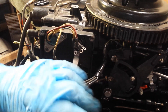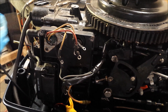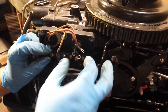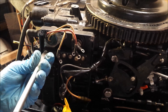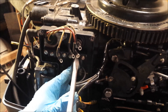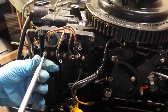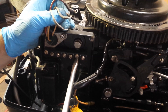Let's get the mounting screw out — that's a ground, by the way. It came with two new screws, so that was handy; didn't have to hunt those down. I did some part number comparing — the one that I had is the wrong one. I should use a longer one, and that's what this one is. Better that I checked that. Now I have the terminal block installed.